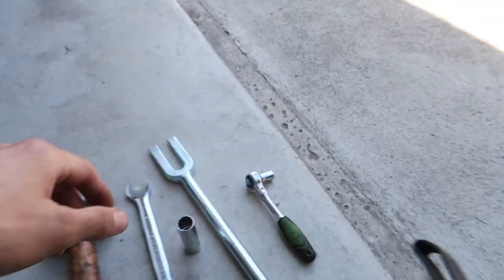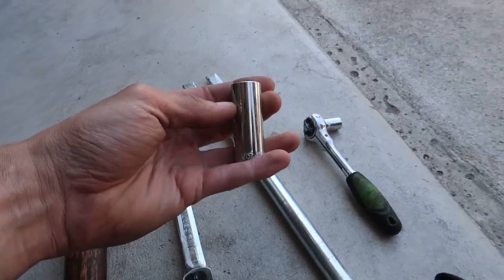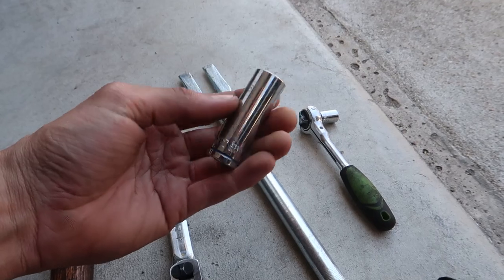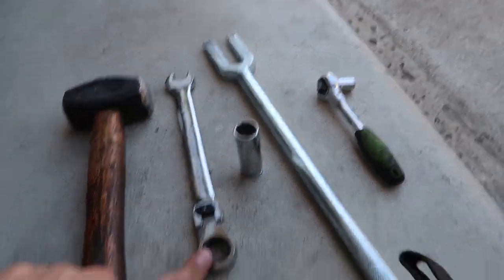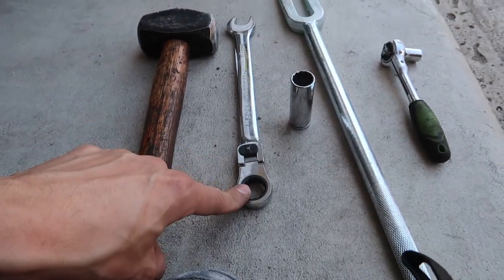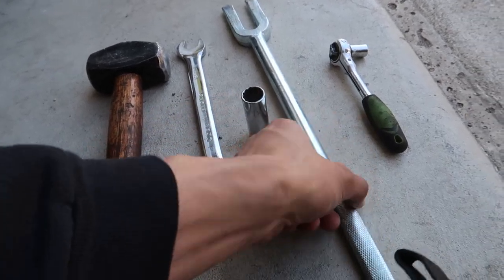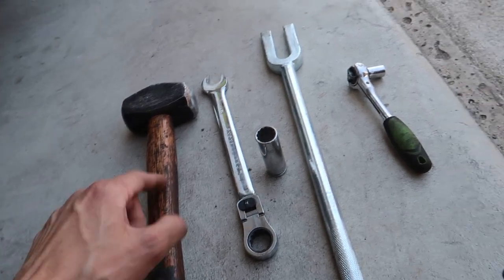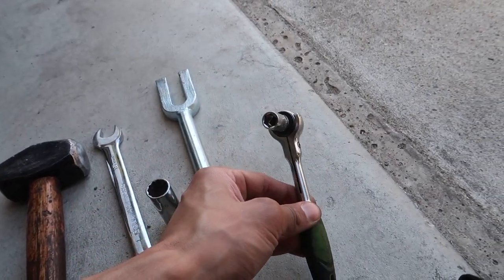This is all the rest of the stuff I used. There's a 15 and a 16 to get the nuts off the bottom of the ball joint. The new ones use a 15mm and 18mm for the nut on the knuckle for the ball joint. The pickle fork — I just jammed it in there and gave a couple taps with a hammer, she popped right out.